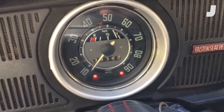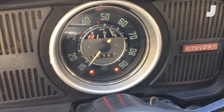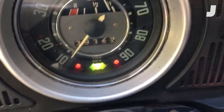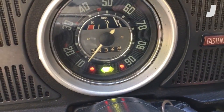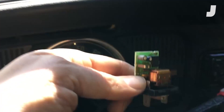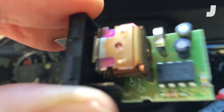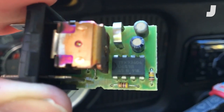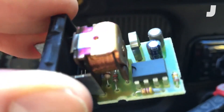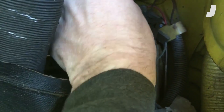Hey everybody, it's me Jason. I'm helping David out with his little discussion about how turn signal flashers work. I'm here in my old Beetle and I'm putting on my turn indicators — you'll notice nothing's flashing, which is very, very wrong. I love indicators and part of what I love about them is the flashability. That's because right here in my hand I've yanked the flasher unit. You'll notice it has a little integrated circuit chip right there — that little IC chip pulses the 12 volts of current from the battery to go to the little relay to actually make the clicking. So I'm going to plug it back in and we're going to see if we can see anything working. We won't get to see a bimetallic strip snapping back, but maybe we can at least see the relay moving, which is of course what makes the clicking.